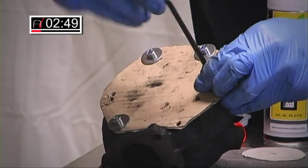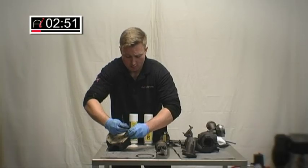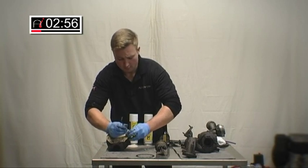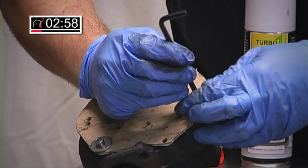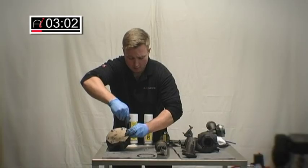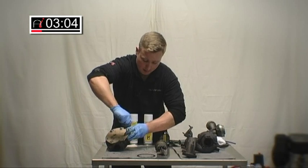In a moment, what we're going to do is invert this turbo and seal the top in the same fashion. We'll apply the first cleaning process — the decarbonising chemical — and leave it to stand for about an hour.